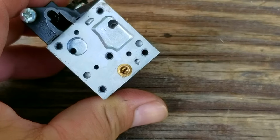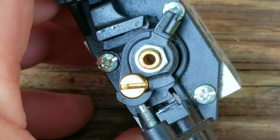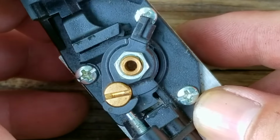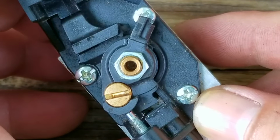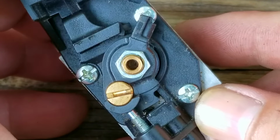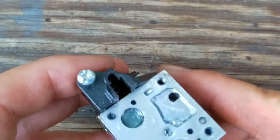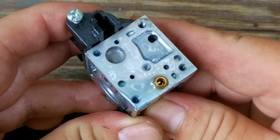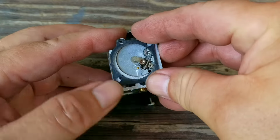There's also supposed to be an L screw for low engine speed fuel adjustment on top of the barrel in the middle of the brass section, but I don't see that it's capped off. This is usually capped off with a brass plug, but I don't think I can adjust this one, so they didn't bother hiding it. After filling the inlet screen with fuel for the flow test, fortunately, this time the fuel passed through the screen. That means we can now start putting the carb back together.